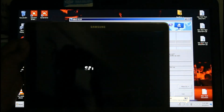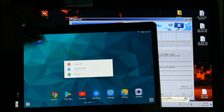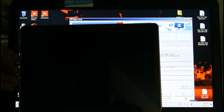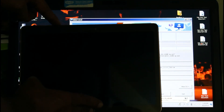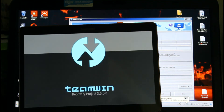After flashing, it's not going to reboot directly into TWRP — you have to do that manually. Wait a bit, then turn it off. To boot into TWRP, press volume up, the home button, and the power button at the same time. Let them go and it will go to TWRP automatically.